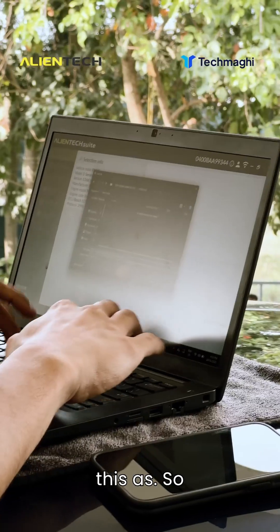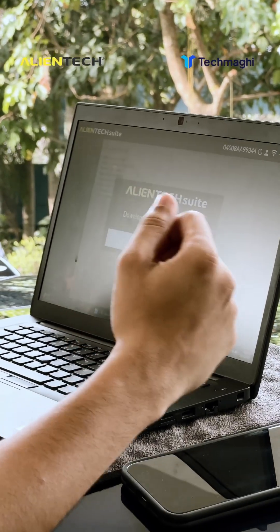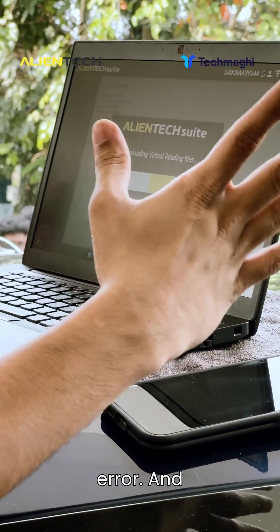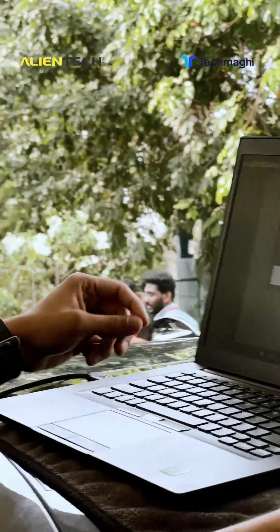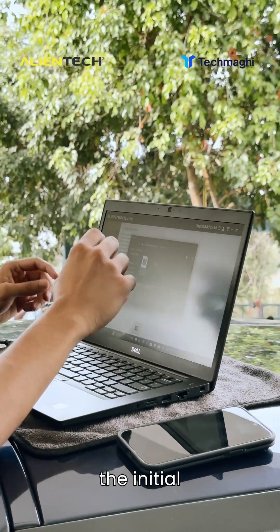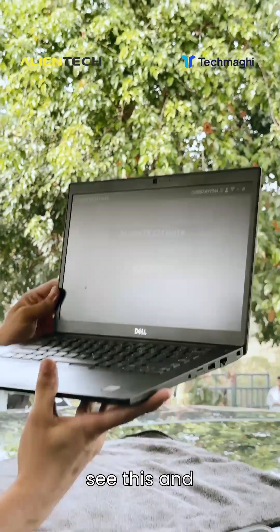I'm going to save this. It is now downloading the virtual reading files — you can see that. The internet connection has to be strong; if the KES3 loses communication with the internet it will throw an error. When writing also you should make sure you have a very stable internet connection, otherwise the writing will stop. Now we have to save this again. This is the original file — just the initial model, ECU number, and every detail. That's the first file. The second file is actually the virtual read.